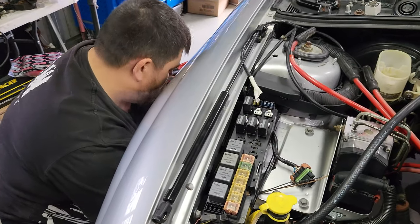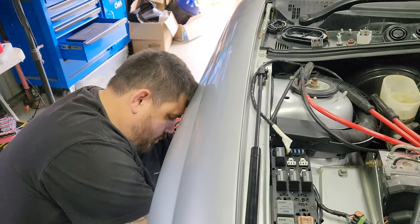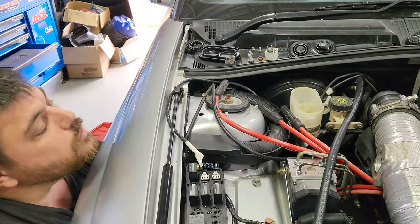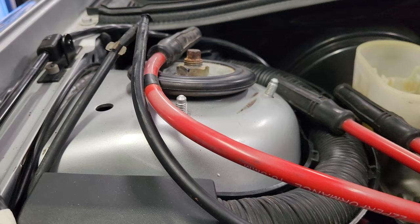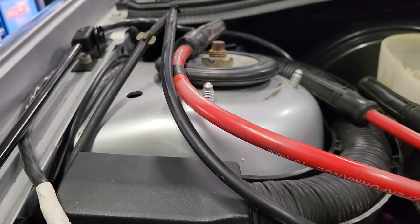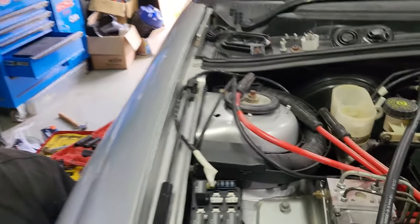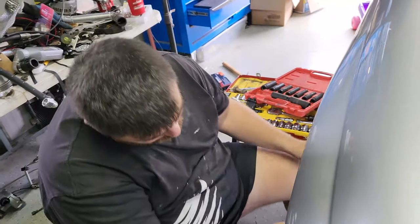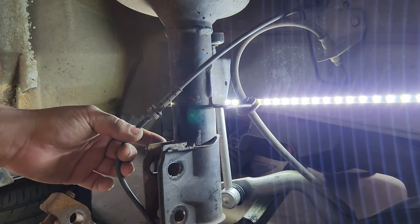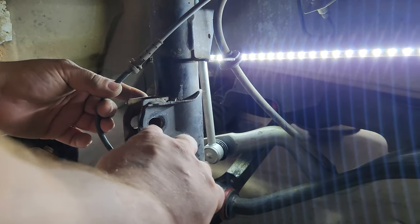Alright, another day ripping the suspension out. How you going Shawno? The suspension is rooted. Hey, can you push that tower up and down? The fact that you can do it just with your hands - yeah, that tower hub is shot. The strut top is gone. She got a video of it when it was on the ground - it literally came up that much. And look at this - should those holes be flogged out that much? That looks very shiny and very flogged out.